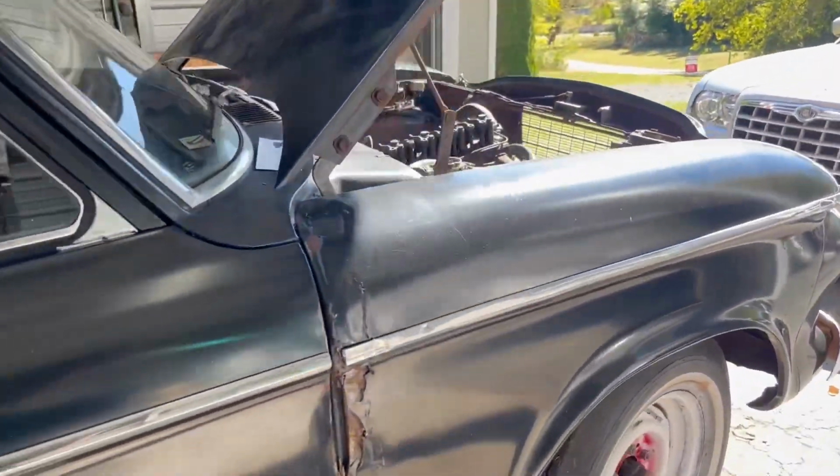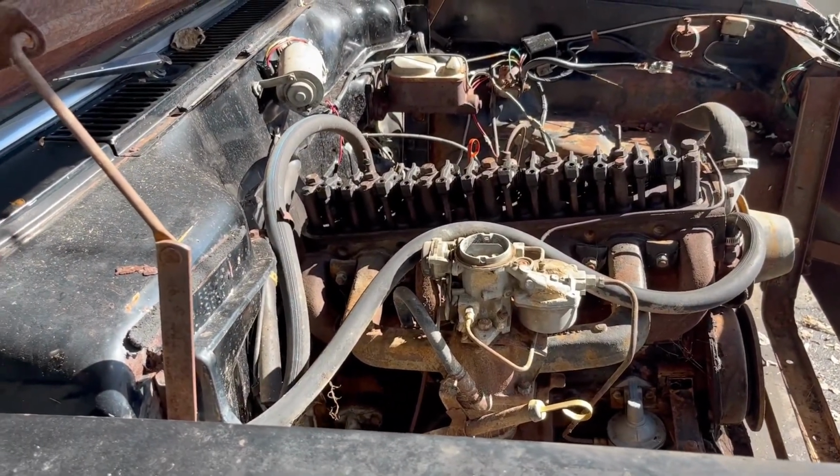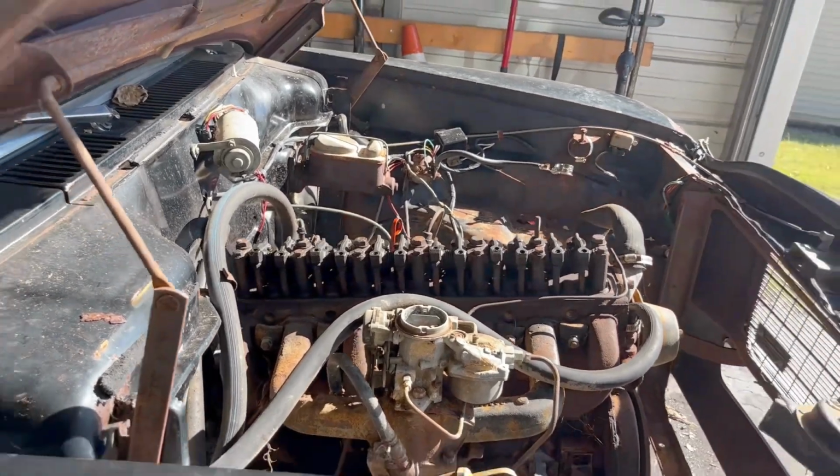We're looking towards right now a Mustang II front-style setup with the rack and pinion and everything. But it's going to be a lot of work. So our game plan is get the car stripped down during the winter. Grab the floor pans and see how it's going to work. We're going to cut everything out of here we can cut out of the way, get the motor. I've got a long block I use for mock-up, bolted up to the NAG1. Get it in there while we get the floor cut out, and find out where everything's going to need to be, what's going to be cut out, what's going to be added.